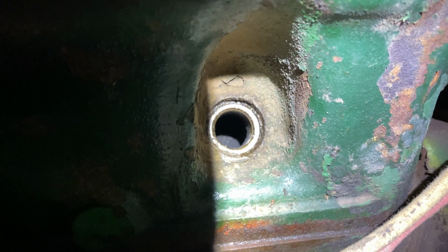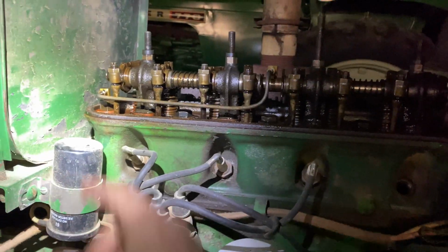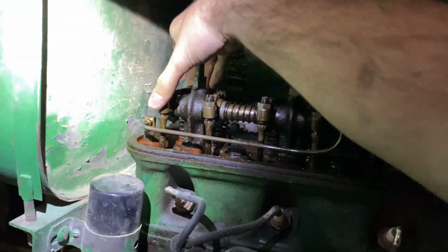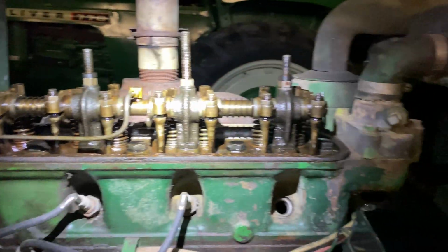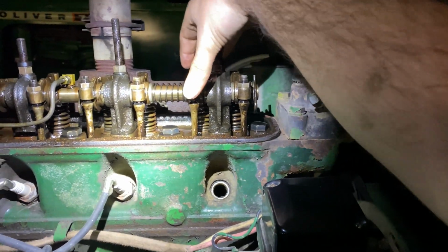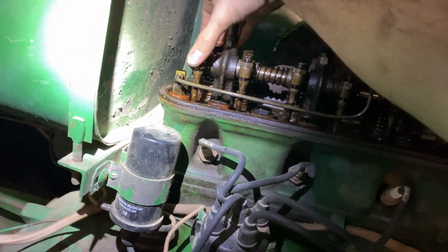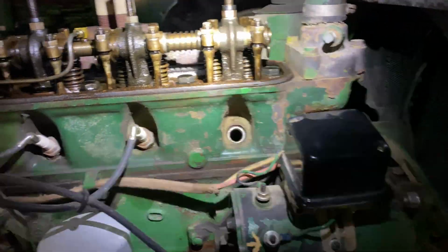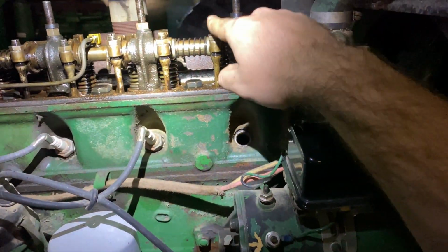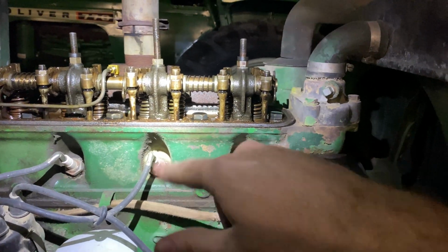Okay, I'm sure you guys can see the piston down there, but it's that little black thing. Top dead center. Technically number 4, because both are loose, so I switched it over. So now number 1 is going to be in rock-over, I do believe. And number 4 is in compression. What rock-over is basically where they have slight tension on both valves. That's the point where the exhaust and intake are overlapping.